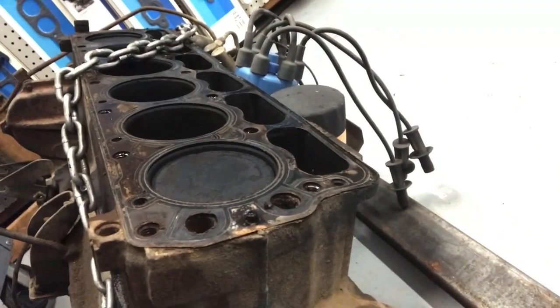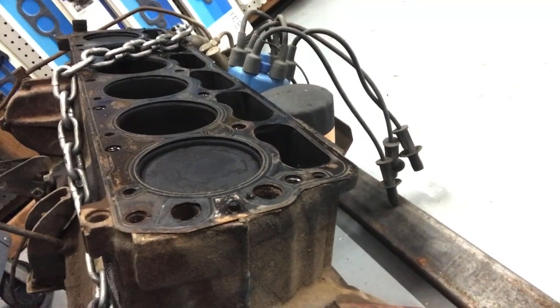We've got some other intake manifolds. We've got a camshaft or a few camshafts that we can actually run. We've got a lot of cool stuff to do on here, but here's another thing I want you to take a look at. Take a look down here. Look at that. Look how far that thing is down the hole. That's ridiculous. So we're also gonna mill the block to get the compression back up, get that thing back up to TDC, make some real power. So with a ported head, cam, get that thing back up to zero deck, it should make good power.